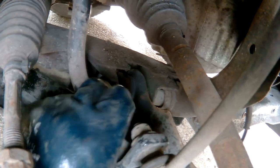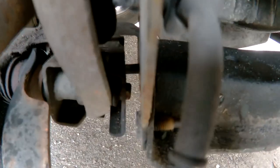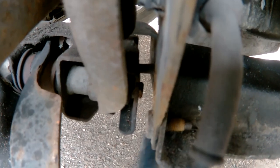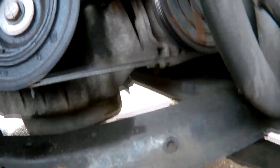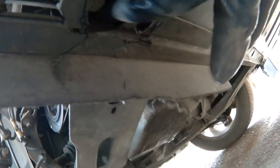Now this bolt there is a long one. You take this nut off and the bolt slides that way. Now because this is here, it stops the bolt sliding backwards. All this is is part of the radiator support. So you go to the front under the bumper - looks like someone's taken this one off before because there's a little square cutout and there's an 18 millimeter nut that you take out, and then it allows you to manhandle this bar out of the way.